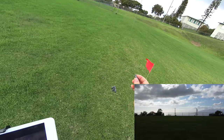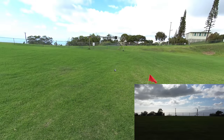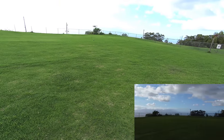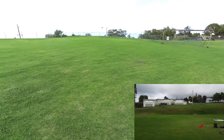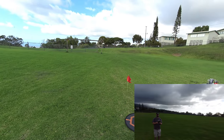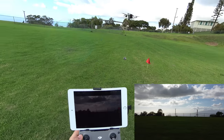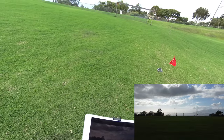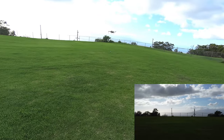The Mini 2 with its lithium polymers is doing way better than the Mini 1 with its lithium ions. One more ounce — so this is four ounces. No warning yet at four ounces. Wow. Here we are seeing the effects of more powerful motors, a lighter drone, and lithium polymer batteries all working in sync. No warnings yet — so that's four ounces of weight. 'Propellers rotating too fast' — that's what it tells you on this one. But it's still flying, no problem. I want to see what happens if I put over... I do have one more ounce, so this is going to be five ounces. It says propellers rotating too fast, but I can still go up. My screen's still recording for you guys to see all these numbers.